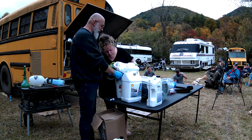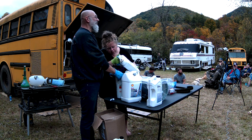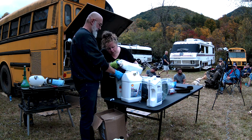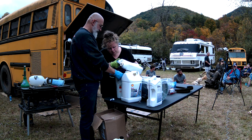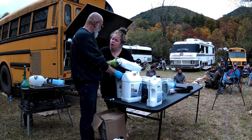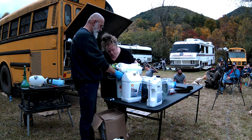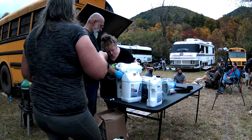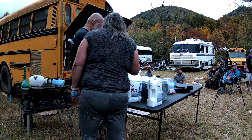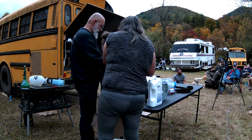Eric has done a lot of research and a lot of work to, quote unquote, bulletproof his engine. If you could take a moment to explain that. Yeah. There are two filters. The Achilles heel of a lot of the engines is the HEUI pump. It essentially creates high pressure oil to fire your injector. It used to be cam driven. Later they came out with the common rail. Now there's another one that compresses the oil to a higher pressure.